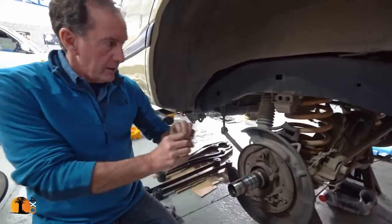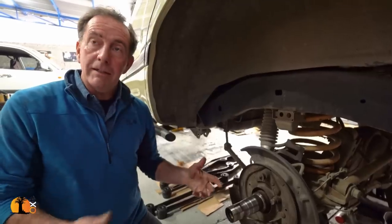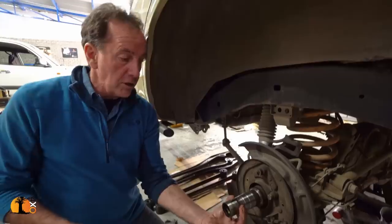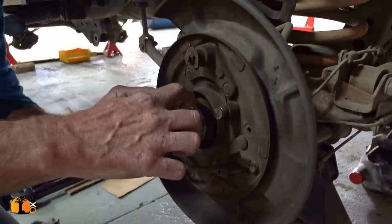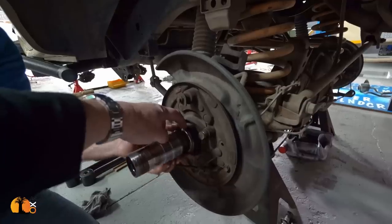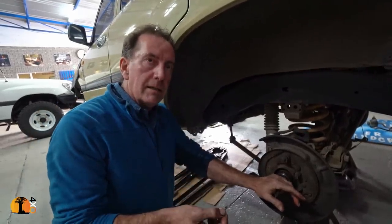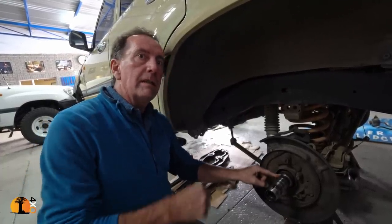Now for the rear — we've got a complete axle here. The only difference with the Land Cruiser rear axle is that it doesn't have a bolt-off stub axle like we had on the front; it's actually part of the axle. In my mind, Land Rover had a much better design because you could bolt the stub axles off and replace them. It's important on this that you make sure the wear is not like we found on the front stub axle, which was worn. This rear axle is actually still in very good condition — a little bit of coloration but no ridge. We've got a bit of a ridge where the seal stands, but it's not a deep gouge, and because we've got the new type of seal it will actually work very well. I just want to make sure there are no sharp edges and it gets cleaned up properly.